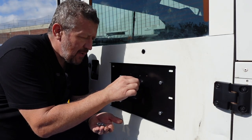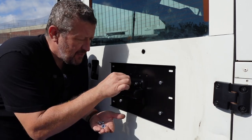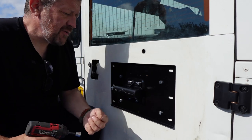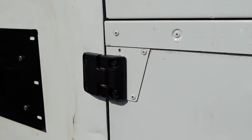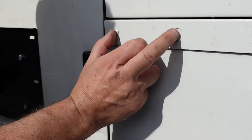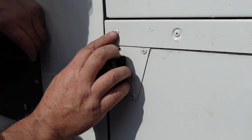Let's get the piston in place. The Mantec logo faces outward so that's the correct way around, and we want the piston on the left-hand side of the vehicle. Just washers and nuts — don't do this up too tight straight away because it needs some movement to allow everything to line up when you've got the brackets and arm on there. Just get these nipped up.